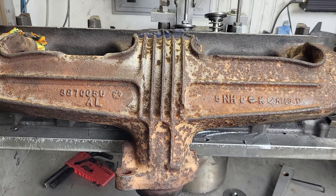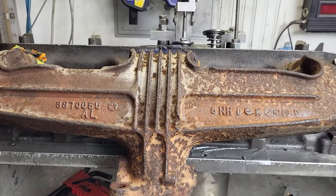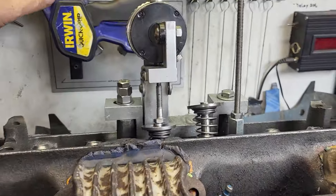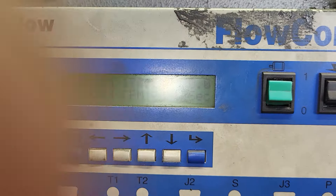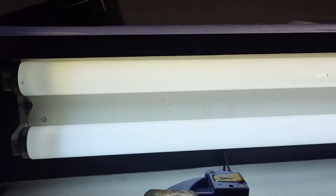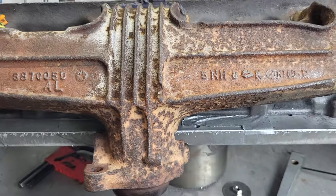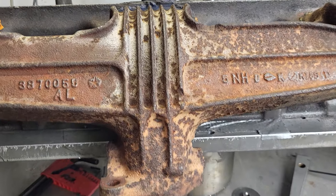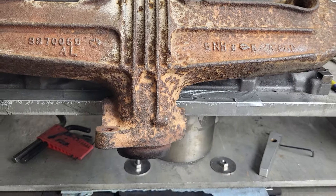Even I don't believe it. I'm just going to flip this on — we're at maximum lift right now. Let's flip this on and see if you guys can see. Okay guys, sorry about that — about 165 CFM now through an exhaust manifold. I don't think that's bad, really.